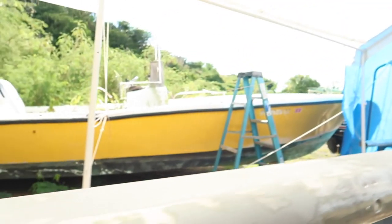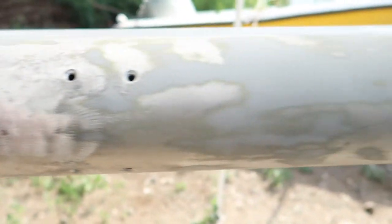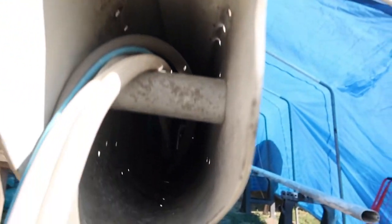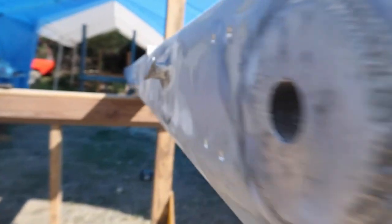So we're here again. Prepping. I just replaced some rivets that hold the conduit that looked kind of finicky, so I put two new ones right there. It's a nice PVC conduit that runs inside of it. I'm going to do some epoxy work today and try and fill all those little holes with epoxy. I just figured out the conduit is kind of loose on the bottom part of it, and I'm going to try and put a couple more rivets vertically like that.